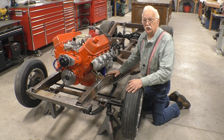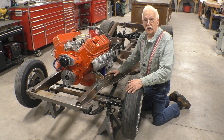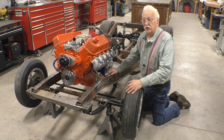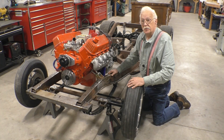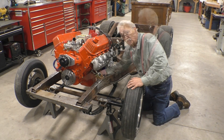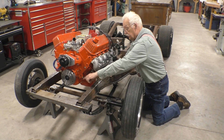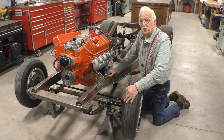I've run into a couple problems with the traditional way of putting a steering gearbox on a frame that has a straight axle and a tie rod in the back. Normally people would go out and buy a Vega box and that would mount right about here — a good conversion. In my case that runs into a whole bunch of stuff, so that's just not gonna work. It really wants to be right where the engine mount is. I could mount the Vega box in front and then have a front steer tie rod, but traditional hot rodders hate that — they don't like the tie rod as a front bumper.